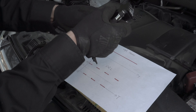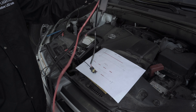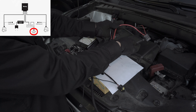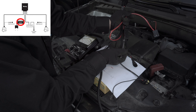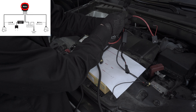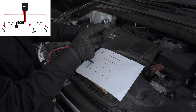After the capacitor, we have this component called the relay. When the power is going to the relay, it closes, allowing current to flow through to the headlights. The battery is what's going to power the headlights, so we need to attach it to the battery. The connector located with the capacitor plugs into the original headlight socket. The power from that goes to the capacitor to output a steady current to the relay, allowing the relay to let the power from the battery reach the headlights for the daytime running lights. The current goes to the relay but doesn't go through to the DRL until the relay allows the current to flow through.